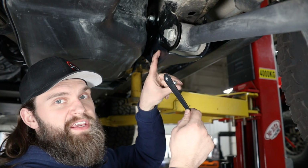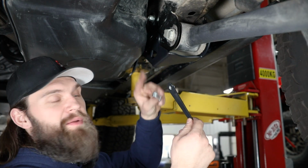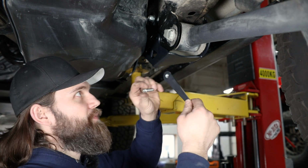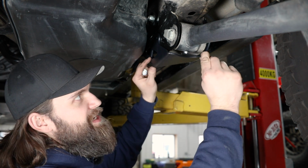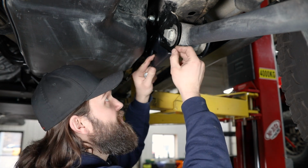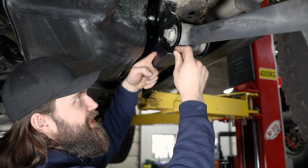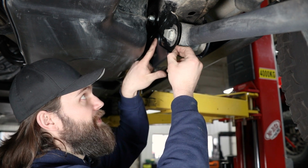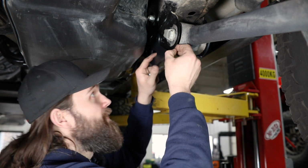So now you can move to the inside here between the frame and the tank. You'll need to find your nut tab along with a 3/8 bolt and washer. Basically this nut tab is going to slide up here underneath the control arm, and then you'll have to kind of manipulate it and get it up alongside of the frame here so that you can line it up and thread the bolt in this location.